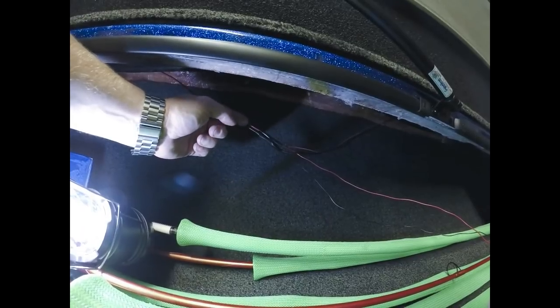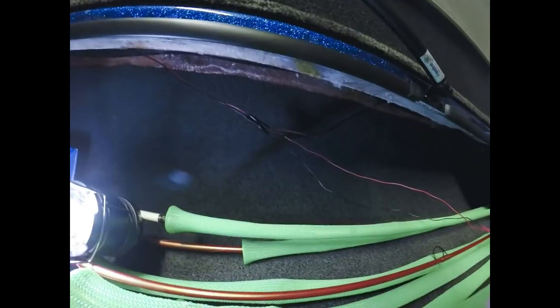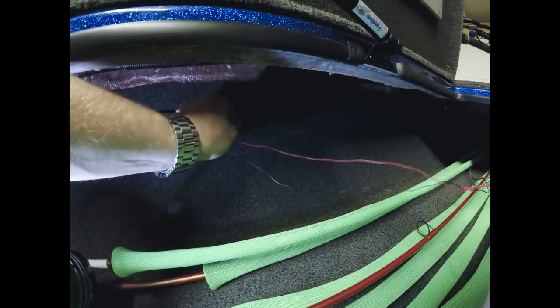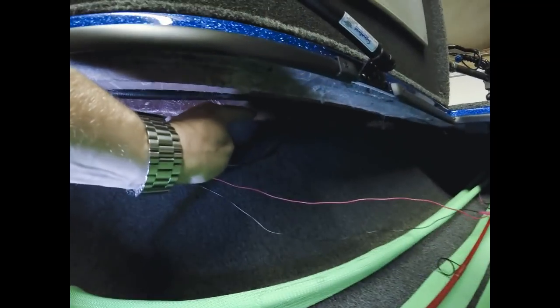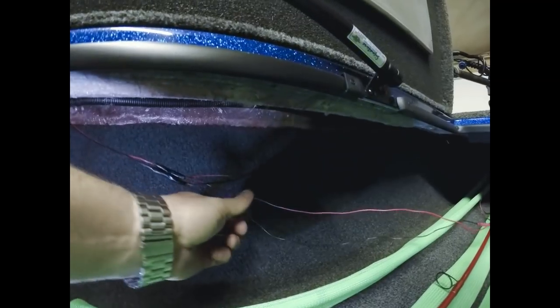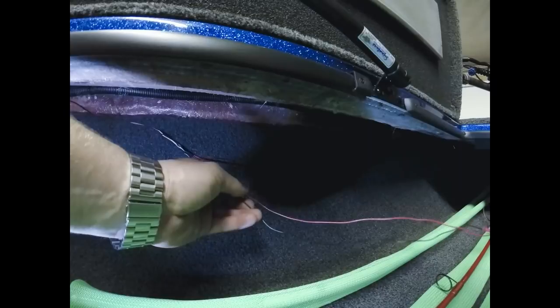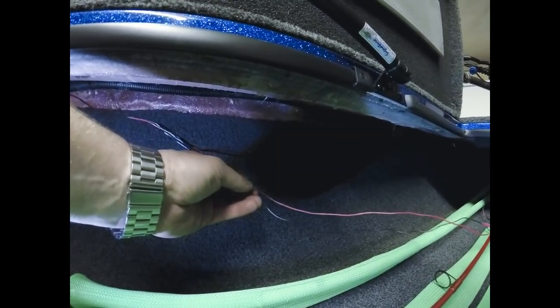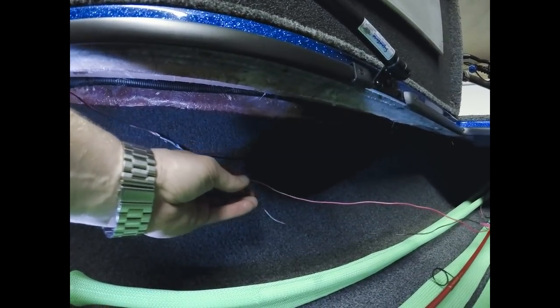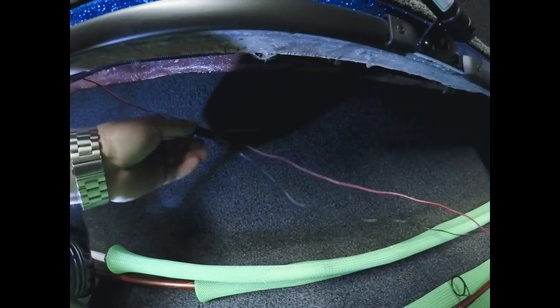What I did is I take them into one side of the butt connectors, crimp them down nice and tight, make sure it's a nice secure connection, and then out the other side of the butt connectors, this red and black wire hanging down from up here is from the middle LED strip, the 12-inch strip. This set of black and red wires, you have to cut to whatever length you're going to need. This is from the installation wire that Bluewater will give you. So into this side of the butt connector I have the black and red going into